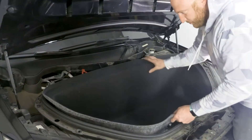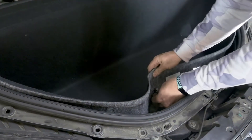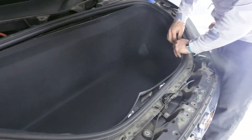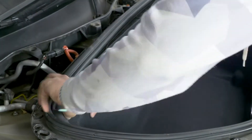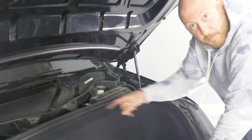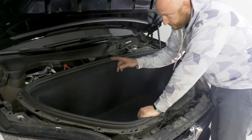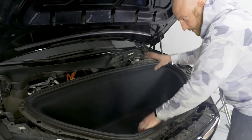We'll put the carpet back in — make sure you plug in the two LEDs in the front. Secure the carpet by pushing down and tucking it underneath the rubber bridge. Now we'll secure the plastic trim — front piece on first, then the sides, then the top. They're just going to push down and click into place. As you're securing the top, make sure you bring the first responder tag out front so that it's visible with the plastic trim in place.